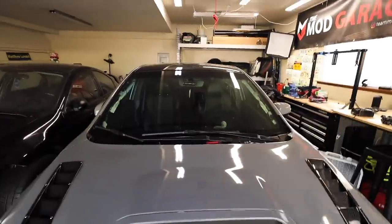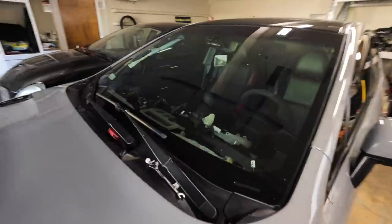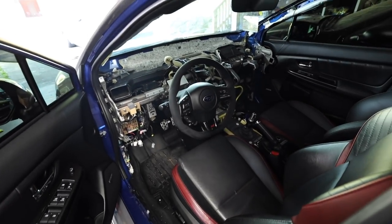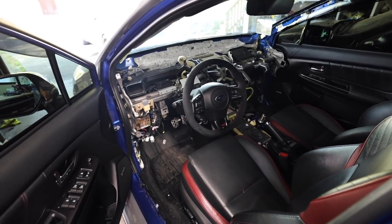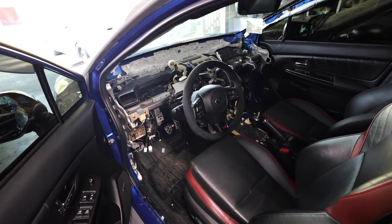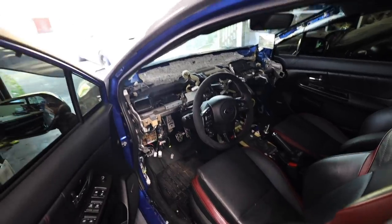For now, in the next video, we're going to pull out all the airbags. We're going to pull out the airbag SRS system, the sensors. I might swap to a different steering wheel at that point and go with a quick release if I want to, since we don't have any airbag systems in the car. I do really like that Type R one, but since the airbag's not functional and we're not going to be able to retain any of the button features on the steering wheel, I might just swap it out for a steering wheel that's a lot more simple. It would also mean that we can clean up a lot more wiring in here that we're not going to be using. So that is what I got for you guys on this one.